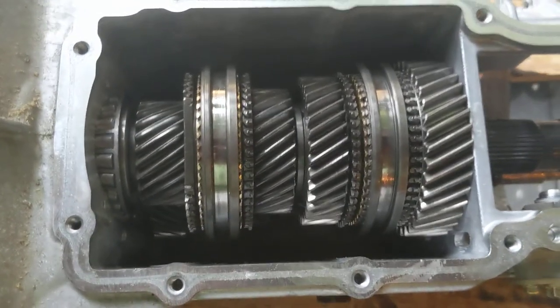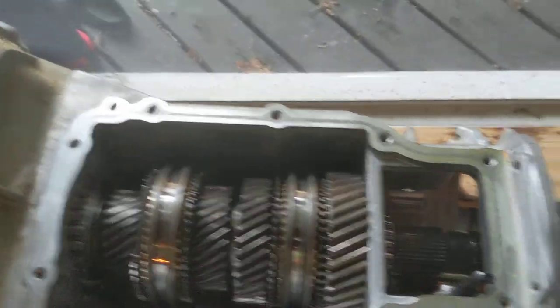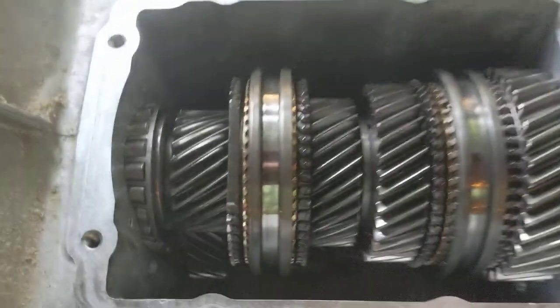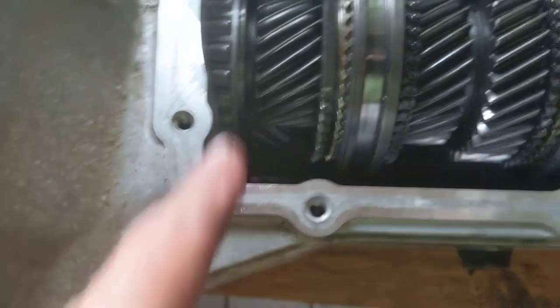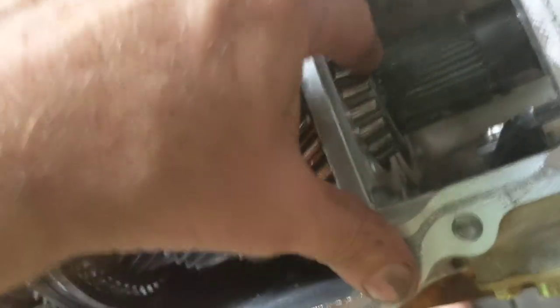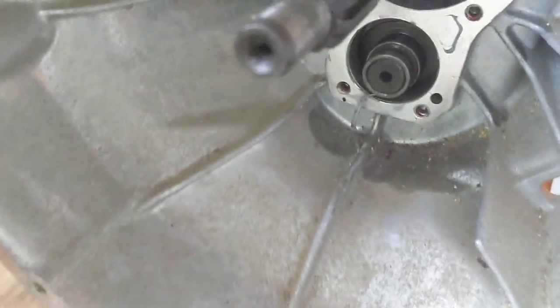Just so you know, I was paused for probably 30 seconds while I lifted the left half and the right half and kind of tilted them together and got them to come together. I did have to fiddle with that countershaft gear down there. The roller element bearing is sitting up here pressing right against the aluminum transmission case. The roller element here is doing the same. There's no bearing or race down there, and there's no bearing or race down there, and that's absolutely required, that you don't put those in yet. Those will happen next.